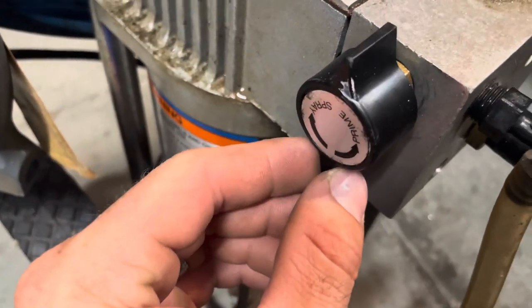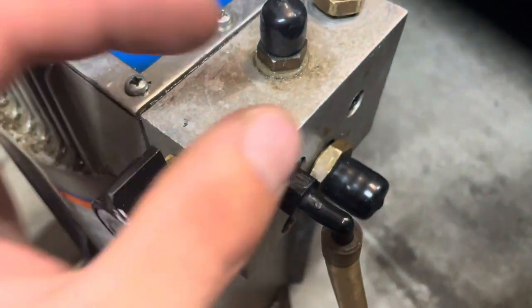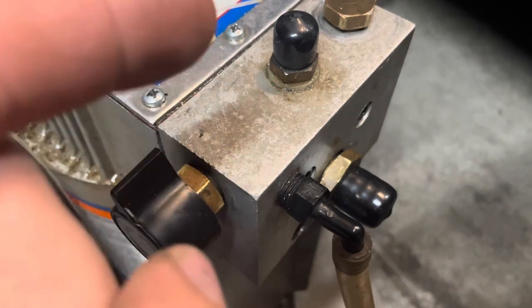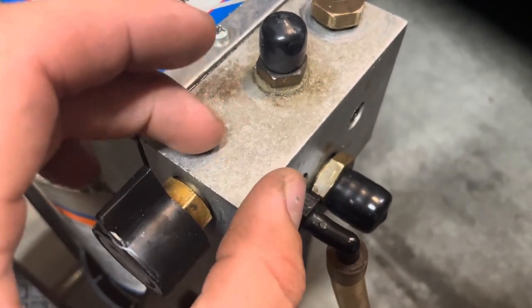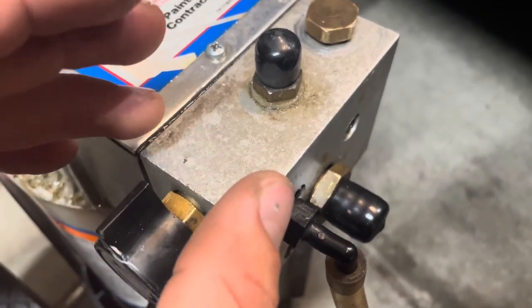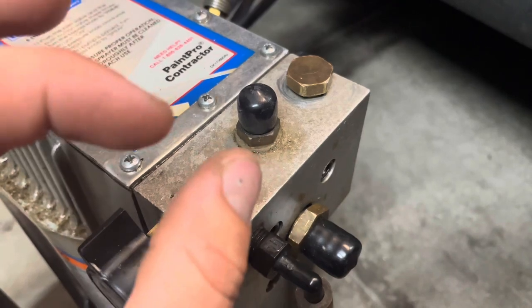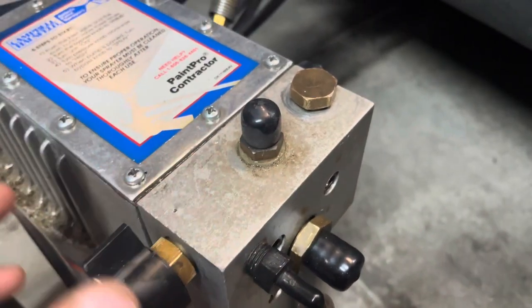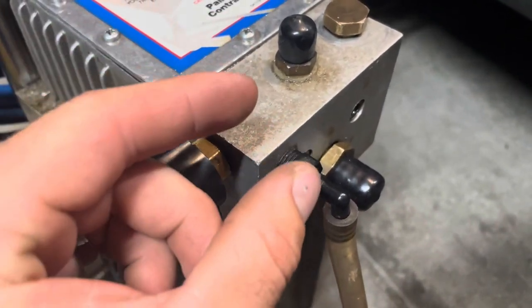So I remembered I took this off to clean it. This is the spray and prime selector. I took this off to clean it, and what you will find is about a half inch in diameter O-ring, maybe a little bigger. It's just a black rubber O-ring. I'm gonna put a link in the description of what I had laying around at the house. I actually had a green O-ring that was from an AC hose that I didn't use on my pickup truck. And it actually didn't work. They sent the hose, but the O-ring I needed was not a round rubber O-ring. It was a flat washer, and it was just a bad design for that hose in particular, but it worked great for this seal.